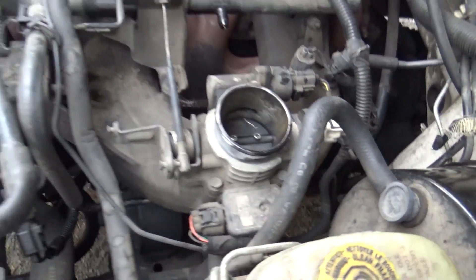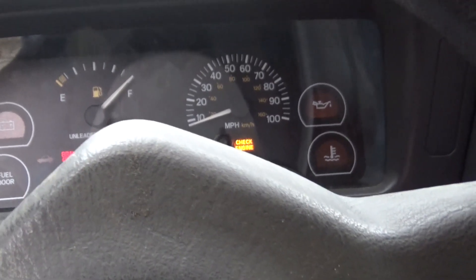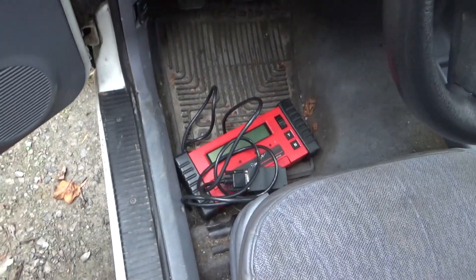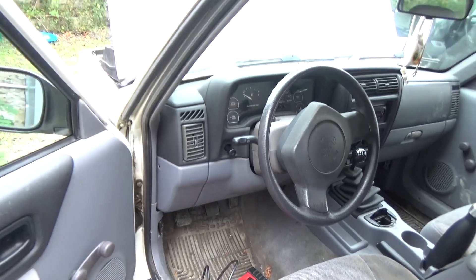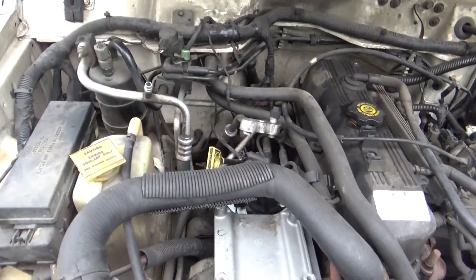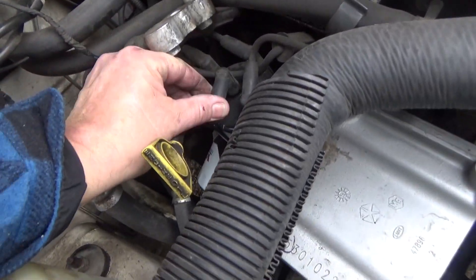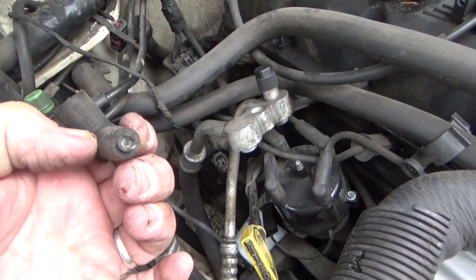I'll pour just a little bit of fuel in the intake to see if the injectors are working. At this point we want to see if it's got any spark — we think it has fuel. The gas is clean and it's got plenty of fuel pressure, so maybe it's not getting spark. I checked all the cam and crank sensors with my old 2500 MT Snap-on. Everything seems to be fine, but once I eliminated that — thinking it's not the computer, it's not anything else — I started messing with the wires. When I pulled up on the distributor, this is what we got.